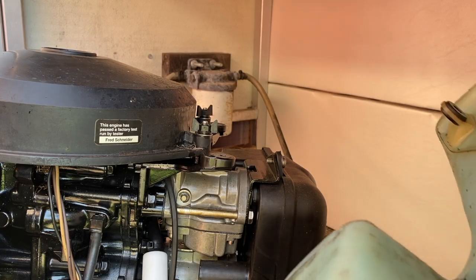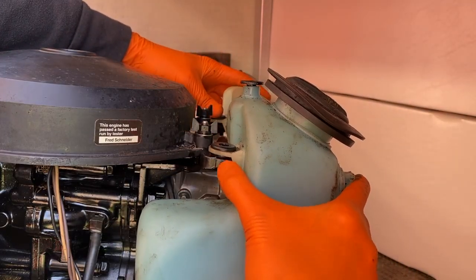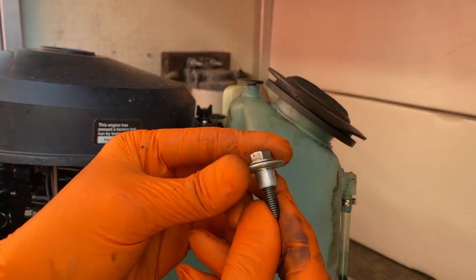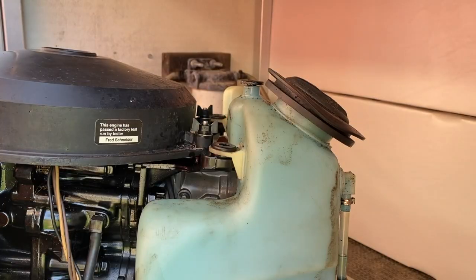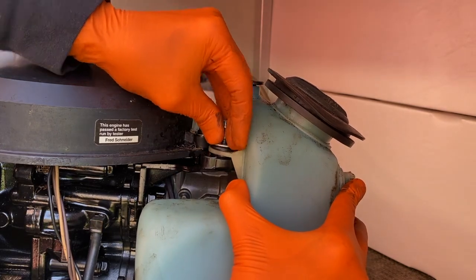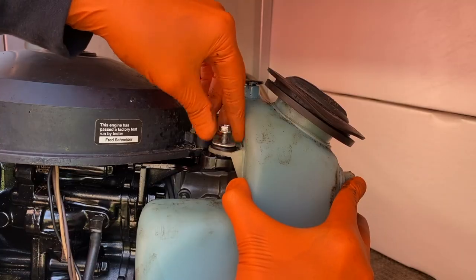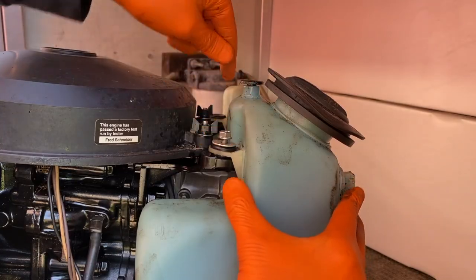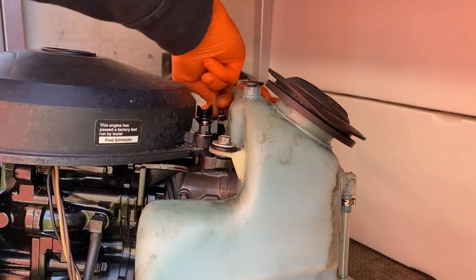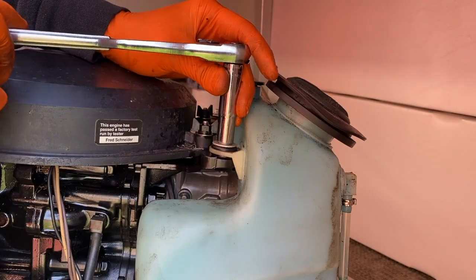I've removed the bungee cord and am bringing the oil tank back in, aligning these rubber grommets. As I insert and lower the tank, just be careful — you don't want to harm any fittings, hoses, or electrical wiring down below. I've got the little plug as well as the 10-millimeter bolt. Carefully align the thread hole and push that in. Do not cross-thread these bolts inside the threaded insert — DIYers, these should go in extremely easily. We'll do the same thing for the opposite end.